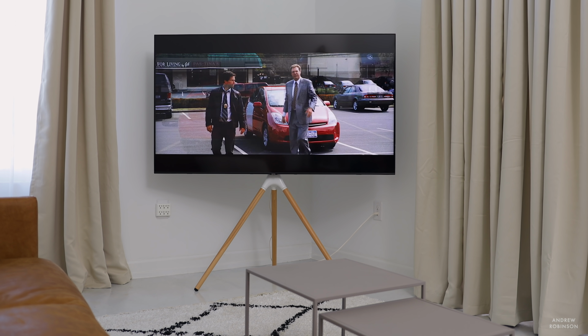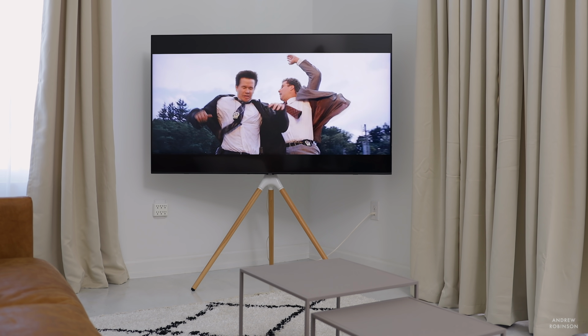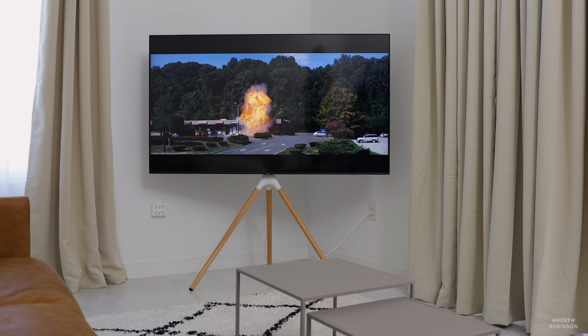One thing to keep in mind, if your TV isn't very bright to begin with, you may not be as wowed by HDR content as some people. In this instance, you may want to actually change your HDR picture profile back to standard or bright or vivid in order to get the absolute most light output when watching HDR content, even though I told you don't do that. But if even doing that, you're still not bowled over by HDR, it doesn't seem very bright, then the problem is likely your television, in which case you might be in the market for a new TV.